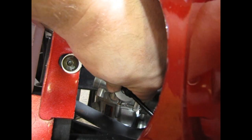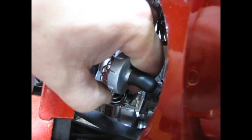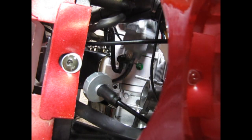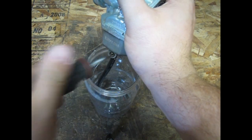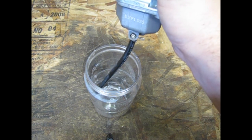After that, remove the carburetor cap along with the slide assembly, and then you're ready to remove the carburetor. Once the carburetor is out, we want to drain the fuel in the bowl, so have a container ready. Loosen the bowl screw on the bottom and let the fluid drain so you can set the carburetor aside.